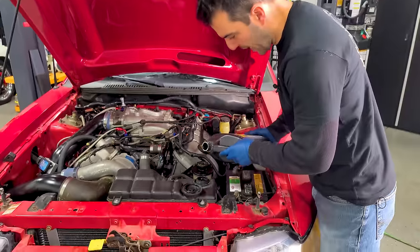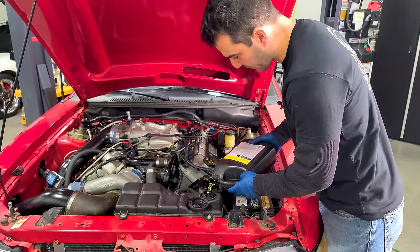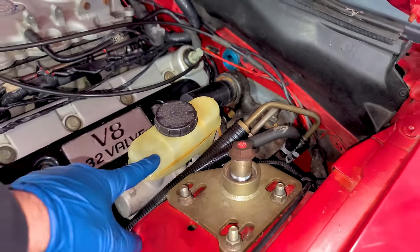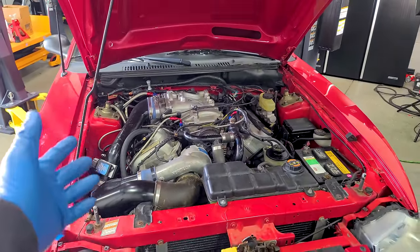Over the last few days I've been adding coolant and letting it bleed itself out — we're pretty much at the top now. After the brakes, I flushed all the brake fluid so it's nice, pretty, and clear. Everything is buttoned up, ready to start. I've only let this run for maybe 20 seconds at a time before — the first time it was running off half the cylinders because of the engine harness. Hopefully it runs much, much better now. Famous last words.